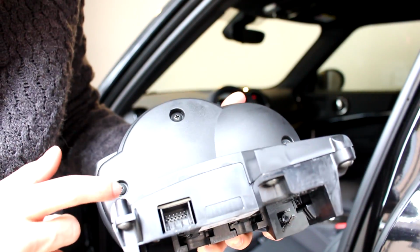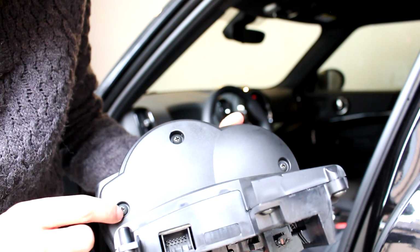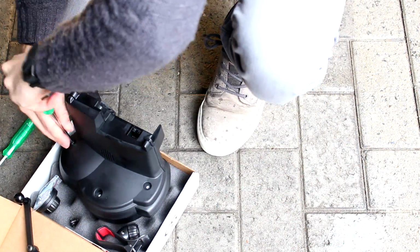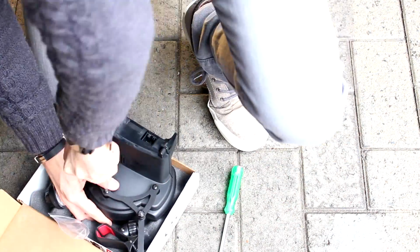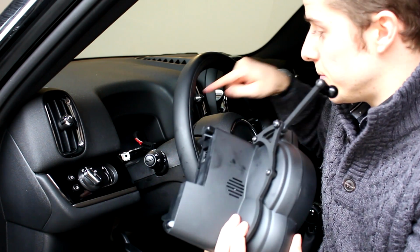Now installing this bracket is pretty simple. We just got to loosen up these 3 Phillips heads, then put the bracket on the back, and then use the new hardware that Cravenspeed provides you with and screw it tight again, because that hardware is a bit longer, and then the mount is on the back of your car. So of course installation is the reverse of removal, so now we're going to put back the plug, put it back on its bracket, put the new 2 Torx head screws back in, put the little grommets back in, and then our mount is complete.